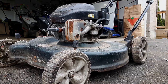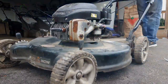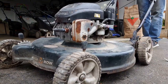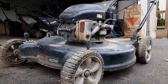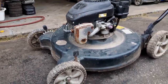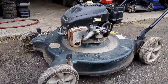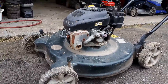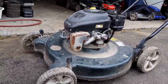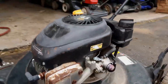I'm not sure if it's getting any fuel in there or not. She does run, but she shook like crazy. I didn't want her to shake herself apart so I stopped it pretty quickly. That's promising though. A new replacement blade would be in order for this, definitely a new spark plug, and a carb clean.